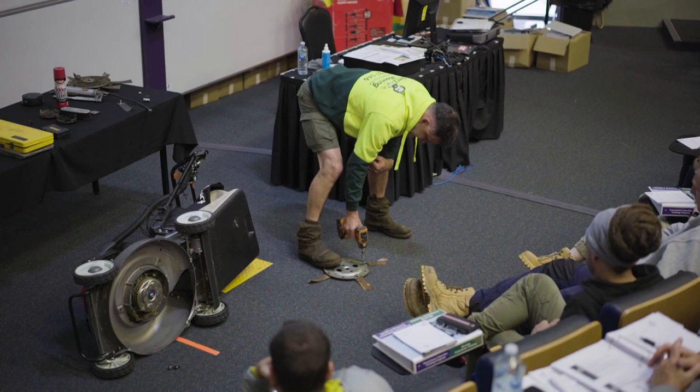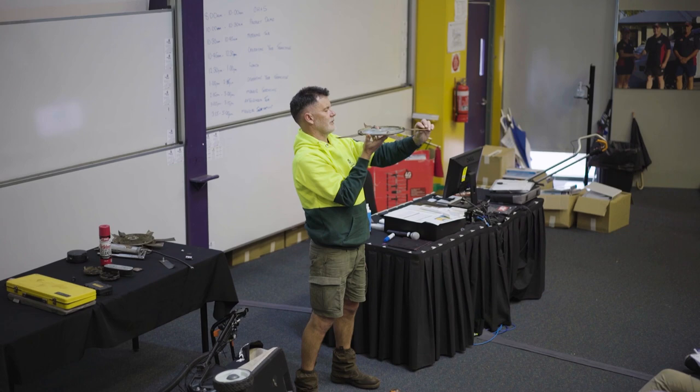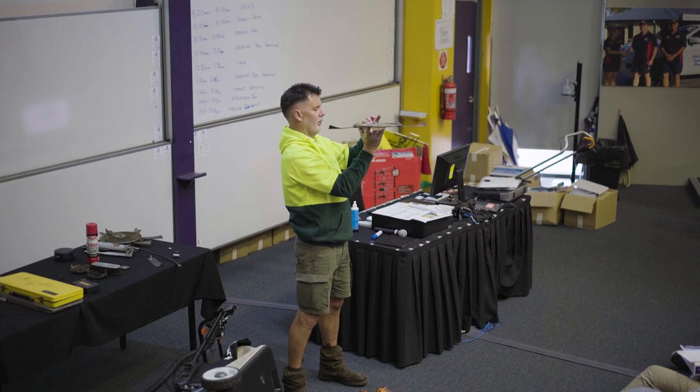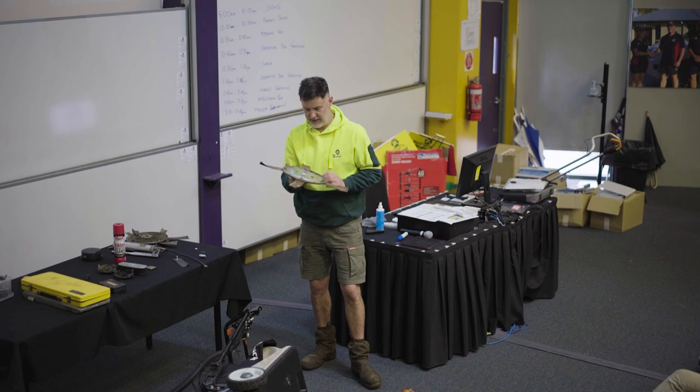So all you do is go around all four blades. You can put four of these throwers on. Honda have two throwers and two flatter ones like that. I've run all four flats for a couple of years because I bought 500 blades for $1 a blade. That probably helped it catch a little bit better, but not noticeably. Okay? Does that make sense? Then all you do is just snap it back on. So I'd be doing that on a monthly basis.